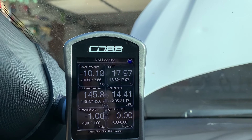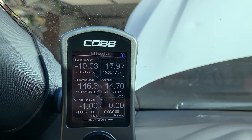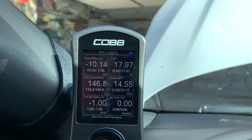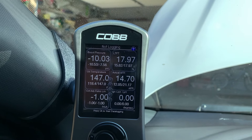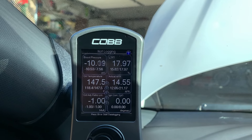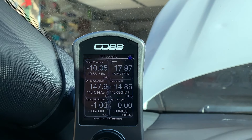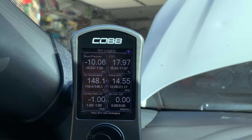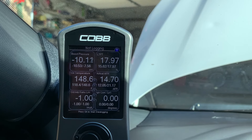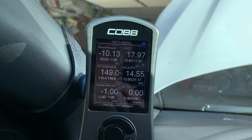Long-term fuel trim should be between about four and ten to be healthy and not causing issues. It's basically the percentage of fuel that your car is adding or taking away — a negative number means the car is running rich and a positive means it's running lean, and that shows you how the car is adjusting. If you're running too lean the number will get really high. It should not be 17 — that's not accurate for my car because the sensor isn't working. For a healthy car running perfectly, it should be between four and ten. If you have an E30 tune this is really useful, because if you have too much E85 you'll start running lean.